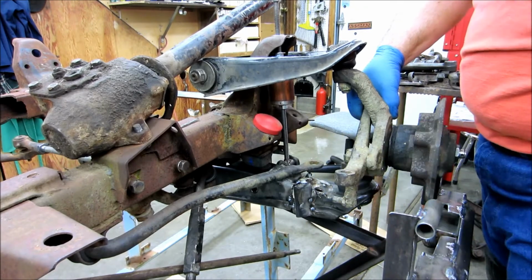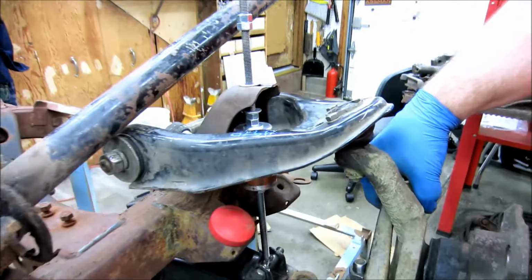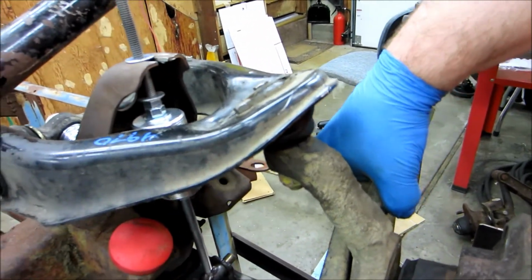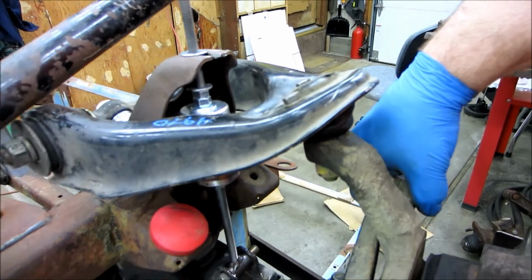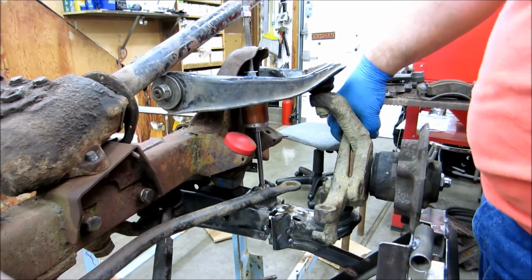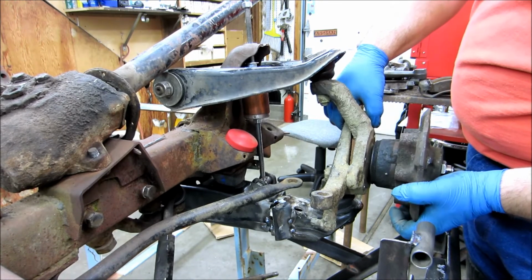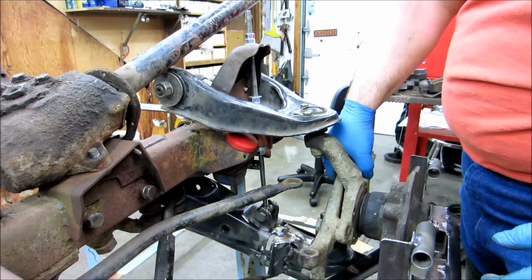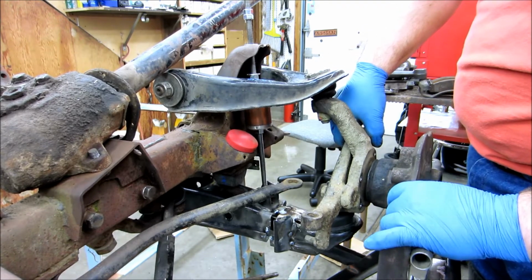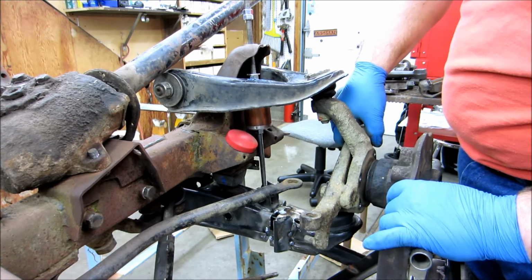to the top, well, I'm not sure you can see that. Yeah, you see how much all thread we still have? I'm up against the bump stop, and I have those nuts and washers set to show me where that hits. So that's way too much squish. I'm losing a lot of my travel here, because realistically it'd be right about there by the time it actually sat on the bump stop. So I'm losing 2 inches of travel there.